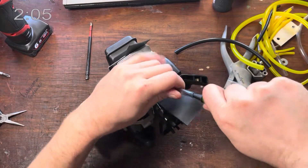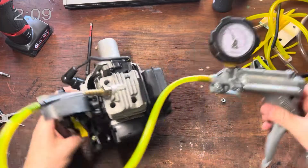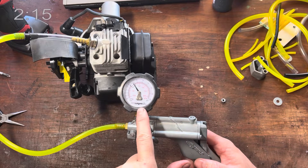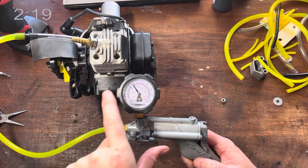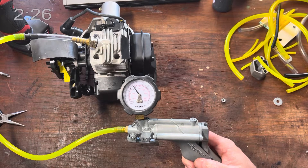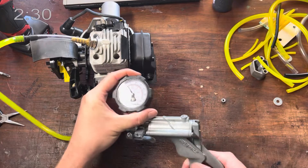Now what I'm going to do is put pressure into the crankcase. You don't have to worry about turning anything over — the pressure will do everything it needs to. You'll see that we've got two dials: we have pressure in PSI, and then we have vacuum in inches of mercury. There are two inches of mercury for every one PSI. We need to go to about seven to ten PSI, which is around about 15 to 20 inches of mercury.